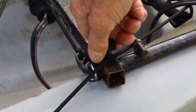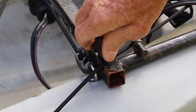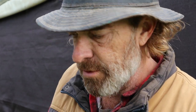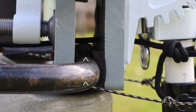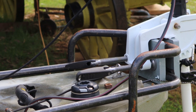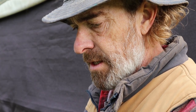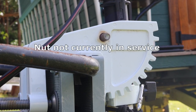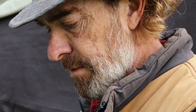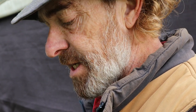I then mounted this rack using the existing holes in the kayak and got these star-headed screw-in bolts which you can easily just undo, so the whole thing can come off via these two screw-head bolts, plus the bolt that went through the frame and down through the pin hole of the rudder system with a wing nut on there. Very easy to remove. The motor itself is now mounted to my system — very easy to remove. I've put a pin through an old boat bolt with a nut on it; you just undo that nut, it doesn't have to be tightened up, it just sits there well, and you take out the motor and shaft and put that away.